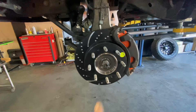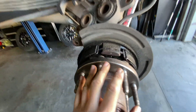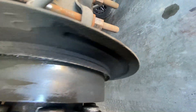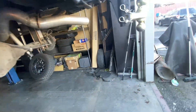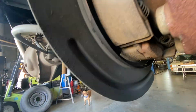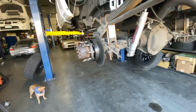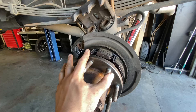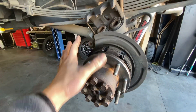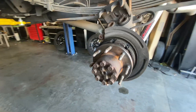Got the front brakes all done with the EBC Stage 8 kit. When doing the rears, I pulled the rotor off and found a bunch of fluid leaking — the rear park brake shoes are just soaked with oil. That means the rear axle seal inside is bad. I checked the other side and it's in better shape but already starting to leak a little. I'm glad I found this before we go to Texas 2K. We're going to tear these hubs apart and replace the axle seals.